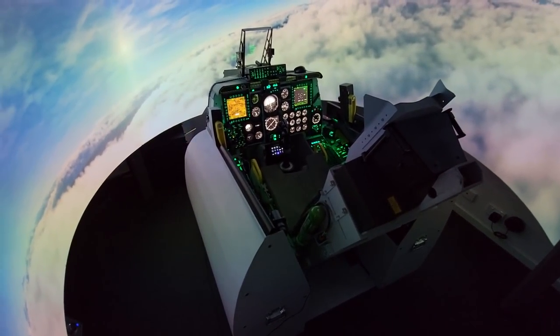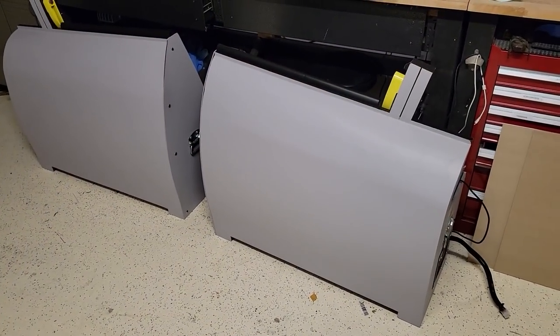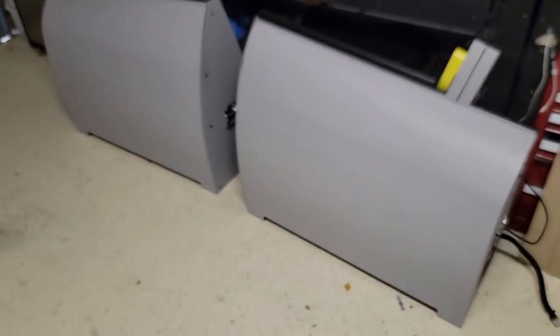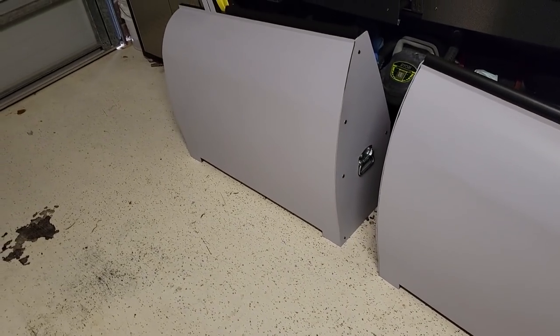What I'm going to do now is disassemble the thing, get it out in the garage and start doing it. Back in the garage, the first thing I'm going to do is touch up some imperfections with some normal car body filler putty. You can see there's some sort of crack down here which I can fill, and I might just try and fix this gap here a little bit better — build that up. Then we'll get into the actual painting.